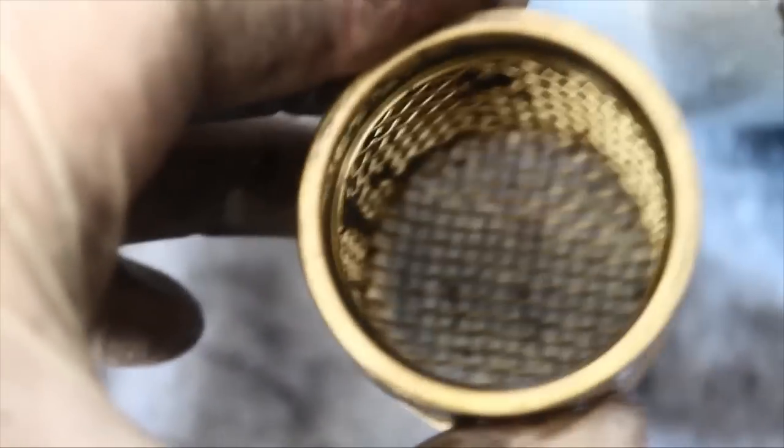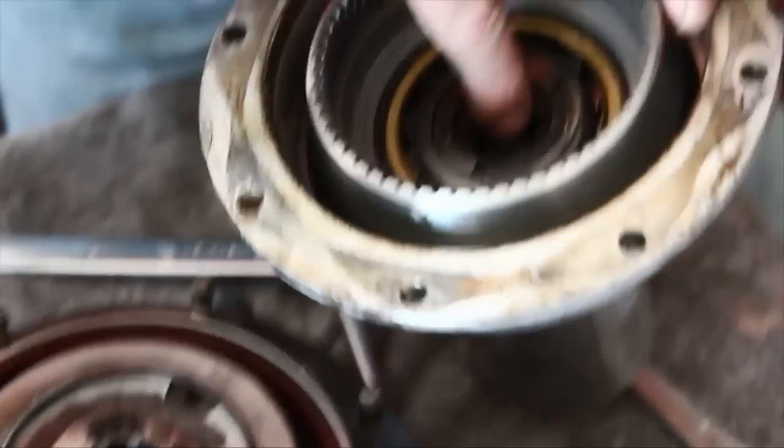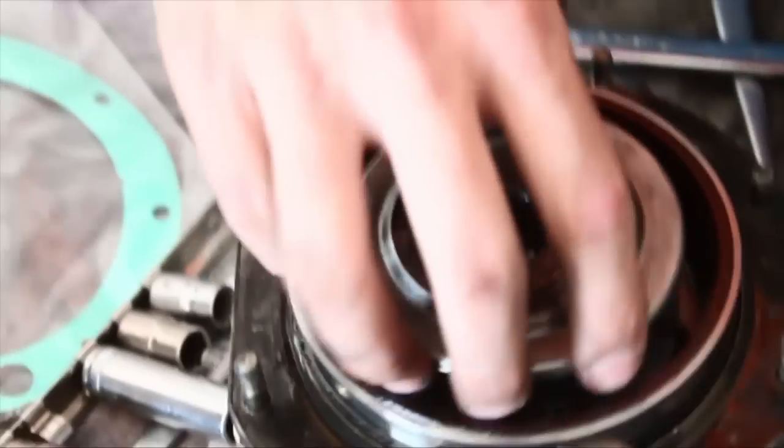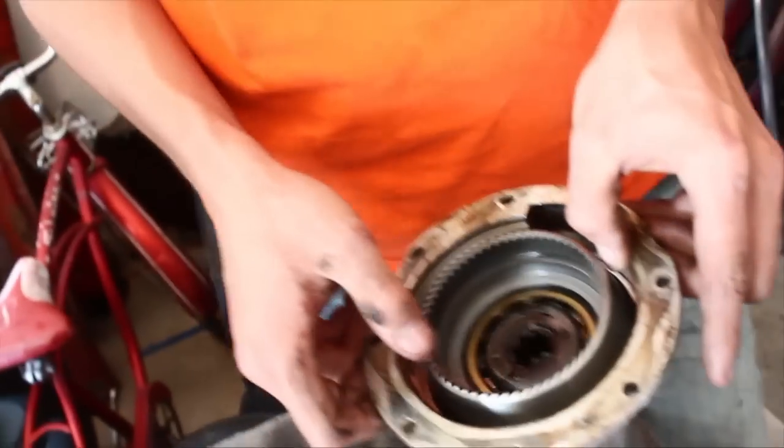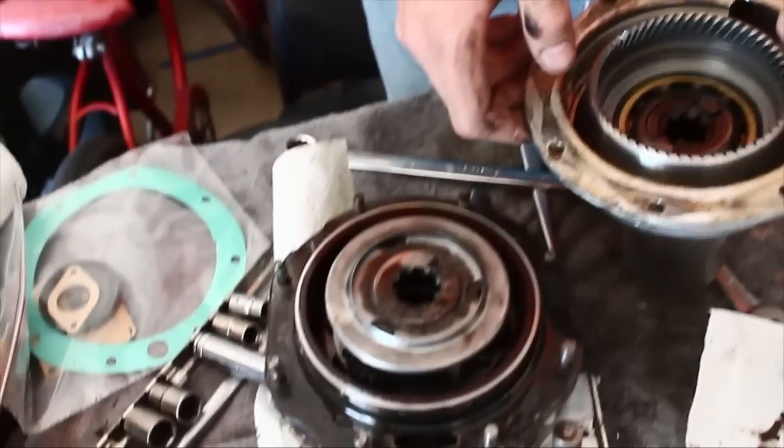Here's our D-type overdrive screen. You can see where all the deposits are from years of oil and crap. The output shaft on the transmission engages here and right there. You've got the planetary gears and the sun gear — you would call this the sun gear, and these are the three planetary gears, because they orbit the sun. It spins nicely because that bearing's in good shape. Now we've got to clean it up and replace that big gasket.